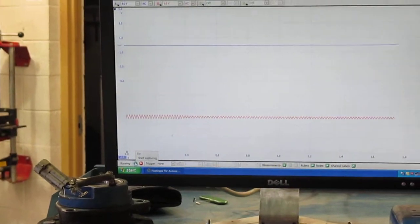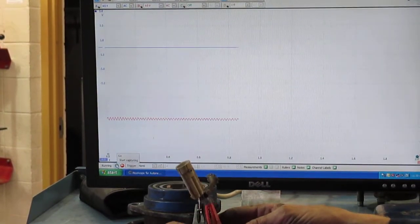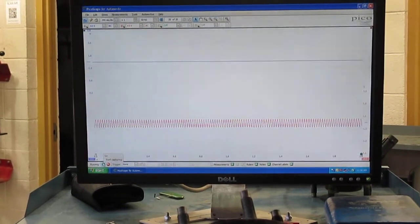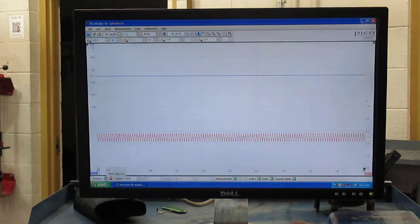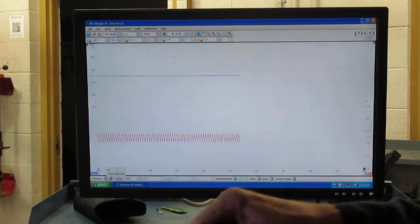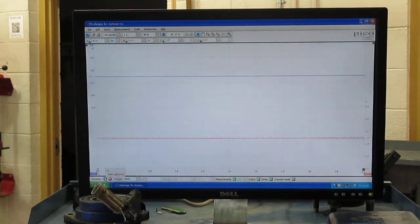Let's look at this other one — this is kind of interesting. It's not open either. We've got a little bit of hash, a little bit of noise. Sometimes this thing starts putting out a signal just sitting here. I haven't even spun the wheel yet — look at the signal we're getting. This caused the car it was on to have an erratic ABS sensation, and it would only ABS brake at speeds below 5 miles per hour, which is just the opposite of what should happen. I'm not even turning the wheel. If I turn the wheel hub, nothing more happens. I'll bet we have a shorted, bad insulated wire condition inside the windings. So here's a bad one — this is just an erratic signal causing some funny problems.